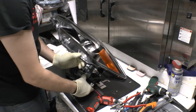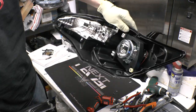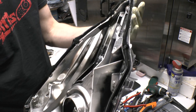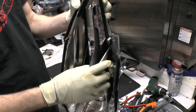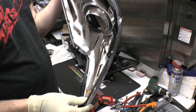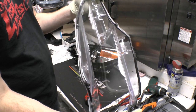I should say permaseal, not butyl — this is a permaseal light, not a butyl light. As you can see, I've got it all open. The channels are perfectly clean — there's nothing in there, I don't even have to do anything else with the back side. The front side though has all of that permaseal on there, so I'm going to show you how I go about removing all that. The first thing I'll do is remove this bezel here. This depends on the lights you're using — some lights it's going to be a little bit harder to get that out, especially if you have little tabs that go into the butyl.